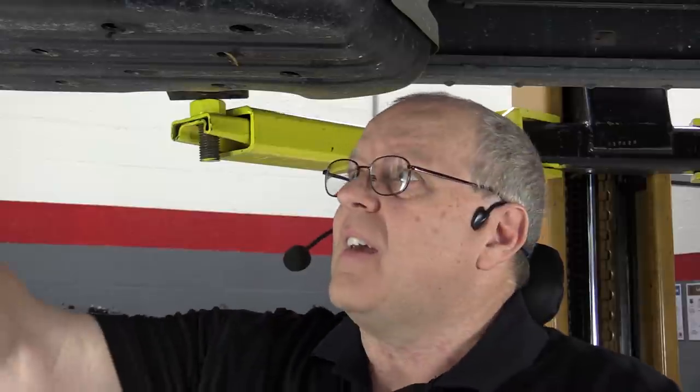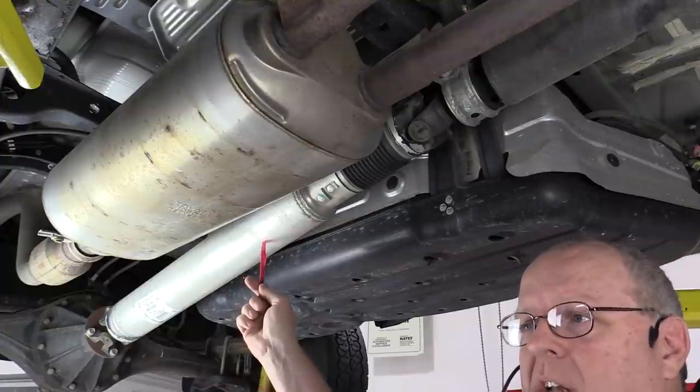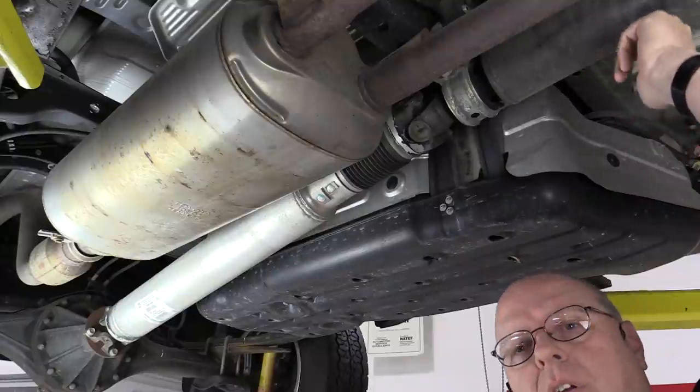There are different materials these drive shafts are made of. The rear shaft on this truck is aluminum, and aluminum shafts are treated differently than steel ones like the front shaft. They have different parts, different service procedures, different U-joints — including coated materials to prevent galvanic corrosion.